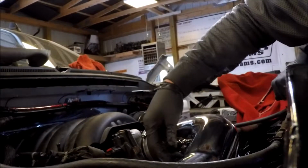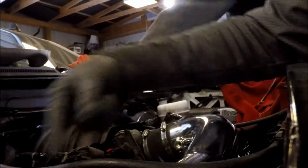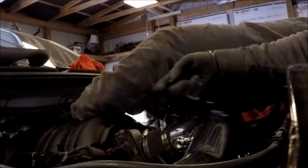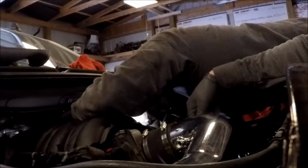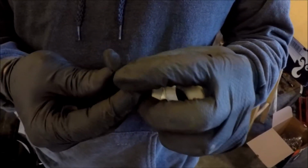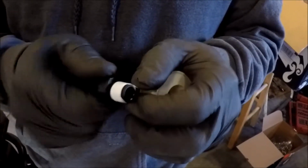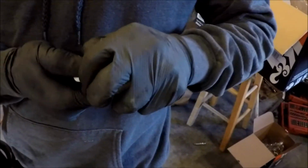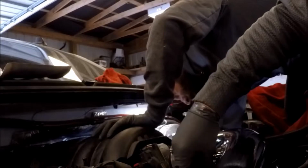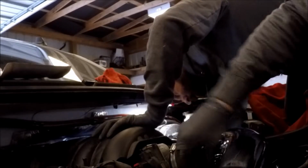Well, you may not hear anything, but this is after the mass airflow sensor. So if there's any kind of leak around these, it's gonna throw your MAF off. Hard in right hand, tape in left hand, and turn it clockwise. See how easy that is? So we got them Teflon taped. Come on, get in there. Just like that.